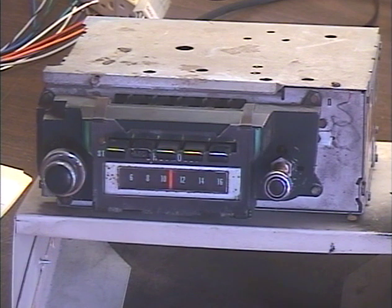And let's go ahead and make sure the customer has requested use of the original connectors on this conversion, and it's perfectly okay to do that. The only drawback is you don't get that big increase in output power that you get when you upgrade your speakers and run new speaker wiring so that the speaker is no longer a common ground system. Going into a common ground system, the output power will be roughly equal to the original radio electronics. But we do have everything working again, so let's go ahead and turn her on.